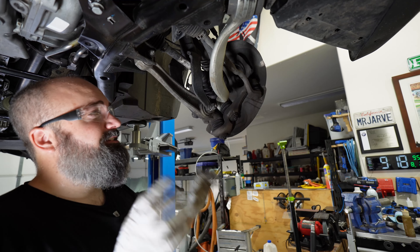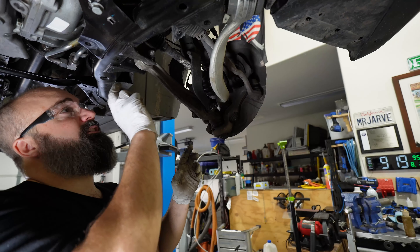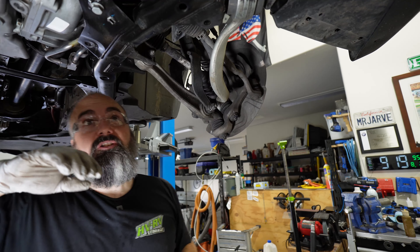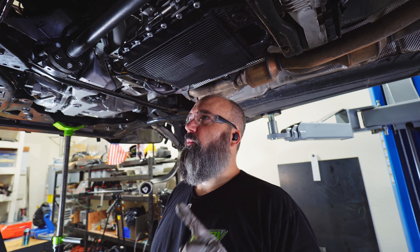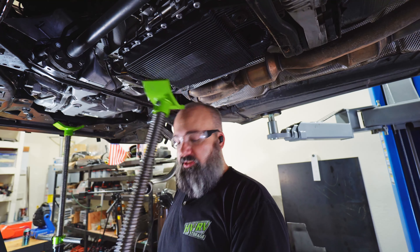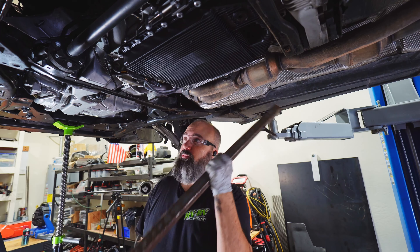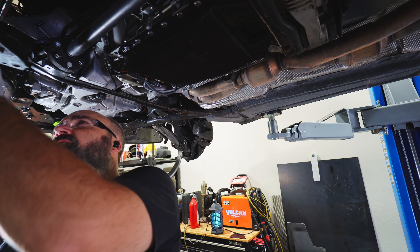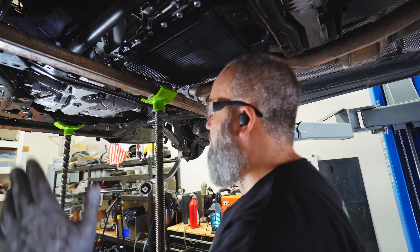Before we can lower the subframe, we've got to take some tension off the suspension. So I'm going to disconnect the sway bar, the thrust arm, the inside lower control arm, as well as the central point on the strut. Then we should have pretty unrestricted access to start lowering this down. Now, if you saw my oil pan video, you'll know the subframe wants to pivot side to side. I only have two pull jacks, so I made this balance bar that I can put across the rear of the subframe. We'll go ahead and pull those rear bolts first, then slide our balance bar in so I can support both sides of the rear at the same time.